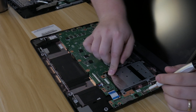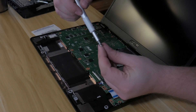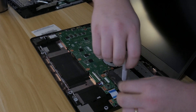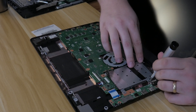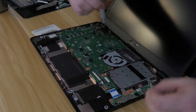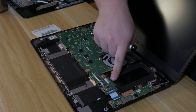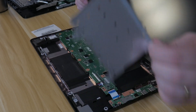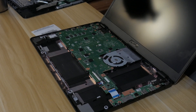You do have to remove the two-and-a-half-inch drive cage, which I'll do right now. There's one screw there, one screw there, one screw there, one screw there. Then this whole piece just slides back, lifts out, and there is your SATA data and SATA power right there. You can screw in your hard drive on the side here, slide it into place, and you're good to go.